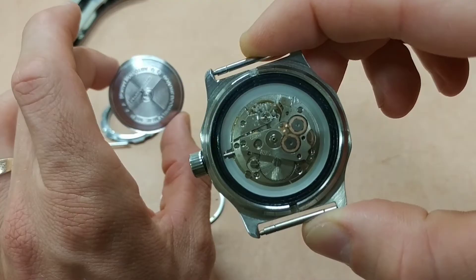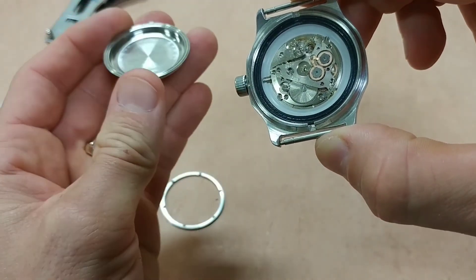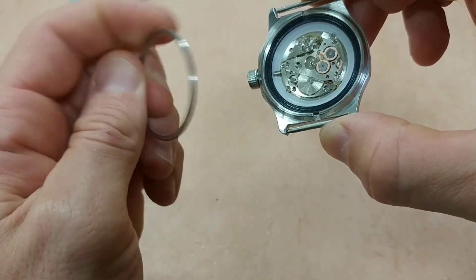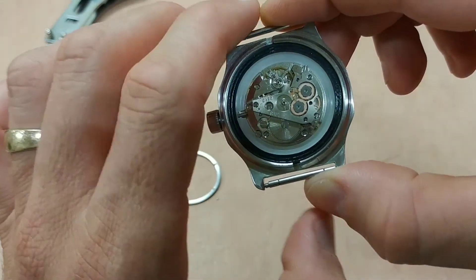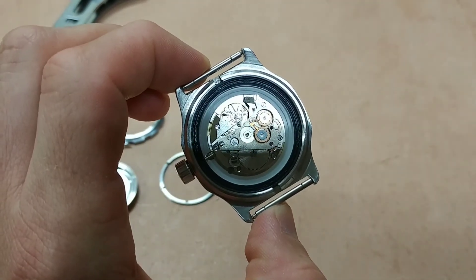It's deeper than I will ever go, and most of y'all too. Anyway, I just wanted to show you how these work. You can see the case back has just got a flat surface that presses on the seal, and then the locking ring drives down on that to prevent shear and torquing of the seal. What a great design — they really came up with something cool here. Thanks for watching the video. Let me know if you have any questions or comments.